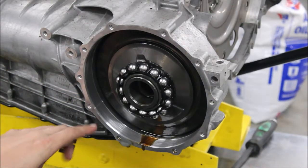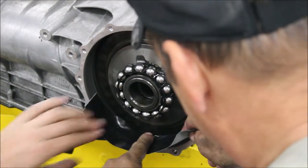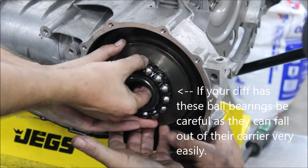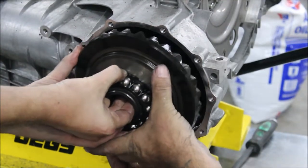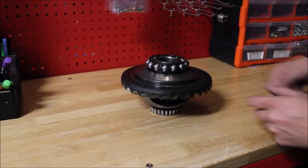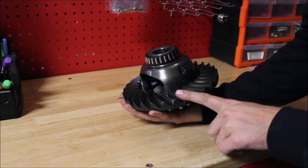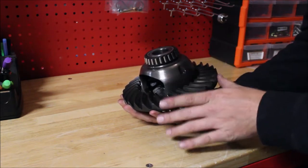Before we pull the diff completely out, we want to make sure that we protect this sealing surface. Be very careful to support the weight and stick your fingers in the middle. The front differential is very fragile — it's important that it makes it to us in one piece without any damage. You've got bearings on both sides that need to be protected well, especially the cages that hold the rollers or balls. If you get any nicks in your ring gear it's going to cause a wear pattern on every tooth of the pinion gear, so you definitely need to protect this really well.